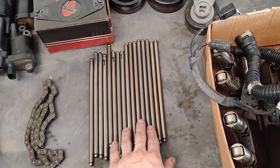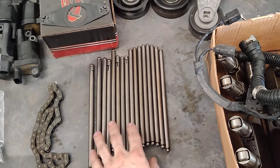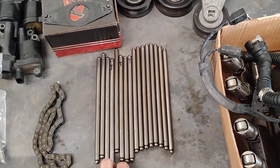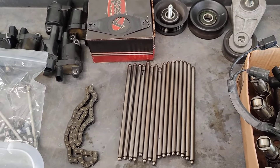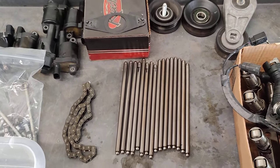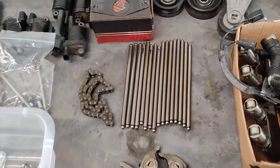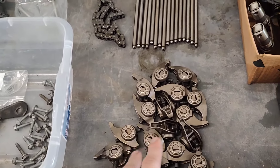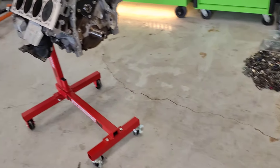The push rods can be reused. You do always want to measure your push rod length as a safety precaution to make sure you're not putting the wrong length push rod in there. Timing chain was good to go as well — you rarely need to mess with those. And we're going to keep the stock rocker trunnion setup. So that's pretty much all that's required.